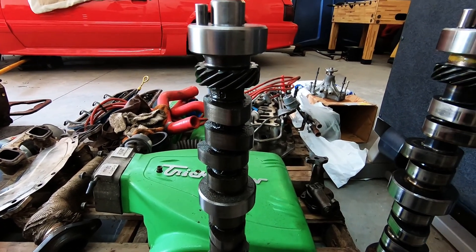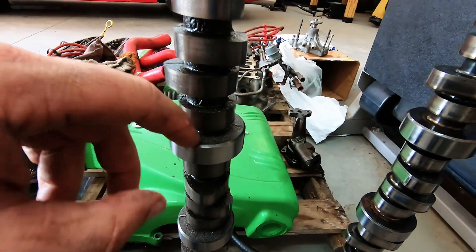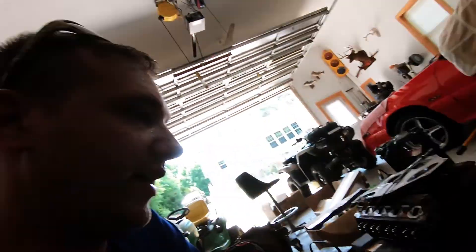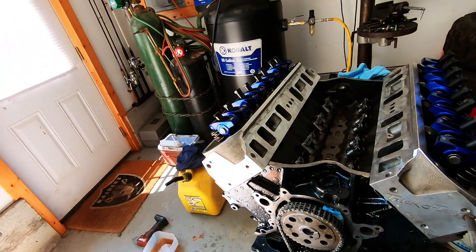The other concern is the distributor gear. You need to know what your cam is made of — this one has sand casting marks, it's cast iron, while the Trick Flow cam is made out of a completely different material. You'll need to change out your distributor gear to match your cam. I can't tell you exactly what you need since I don't know what you have, but there's plenty of write-up on it online. This is the gear for the 302 and this is for the 351. I'm just going to go ahead and change it out — it's $30 and less of a headache to do it now than to risk grinding down a distributor gear and having to tear down the motor to replace it later.